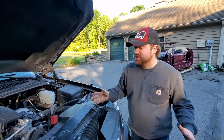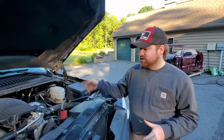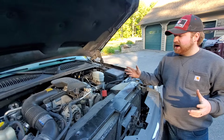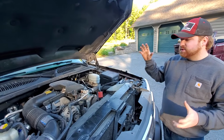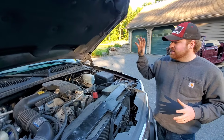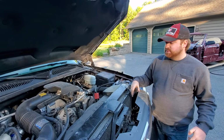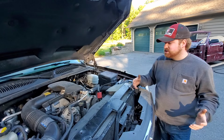Other common issues include the injector wire harness has an issue with rubbing through, which is pretty easily rectified. And not as much necessarily a problem, but the turbo inlet mouthpiece is very restrictive on these engines, but that can be swapped out as well without too much of a problem.